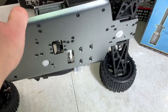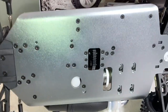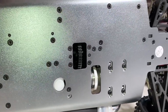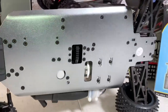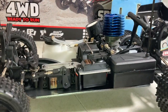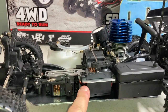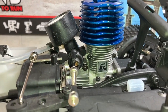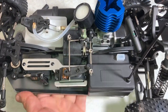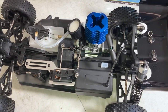On the bottom of the chassis you have, as expected, a smooth flat chassis, easy to work on. You have all metric hardware — no Phillips screws here. The fit and finish on this VRX is honestly blowing me away: the awesome dampening of the shocks, the fail safe being correctly set, the Force 18 pull start engine, the awesome linkages with a slide carb which is quite rare for a small block engine. I'm excited to go run this.